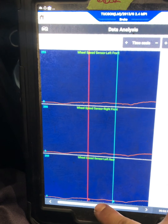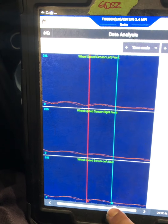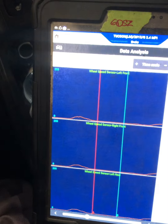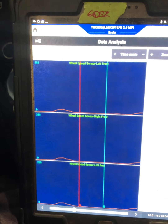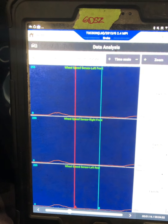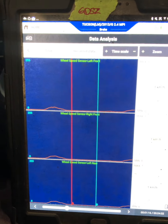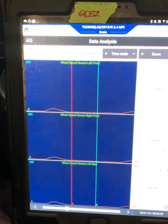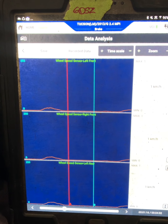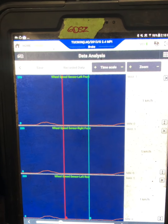At least we know that there's something wrong, and we know it's the left front wheel. So now what I'm going to do is double check and see if our tone ring is damaged — cracked or split — or whatever can cause that signal to drop out, or it could be the sensor itself dropping out. Let me lift up the car, remove the left front wheel, and inspect the tone ring on the driveshaft.